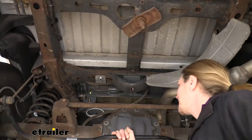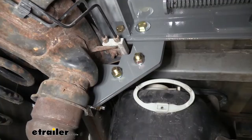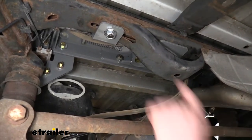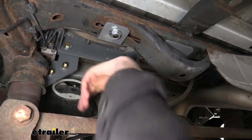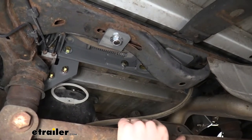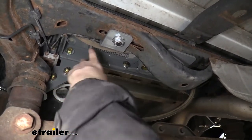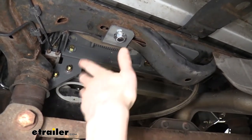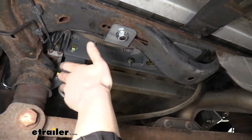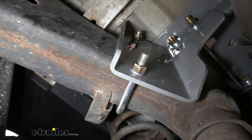This is what our hitch looks like installed from underneath. You'll receive the center section as well as all the bracketry you need to attach it. You can see how it attaches to our center crossmember as well as to the side of the frame. The only drilling that's required is the large hole for your ball and the release mechanism up top. Down here below, all the bracketry is custom fit, specifically designed for this vehicle — there's no drilling required. It all just lines up into place and you bolt it together. Everything here is in a pretty decent spot too; the bolts are all fairly easy to access and easy to torque.